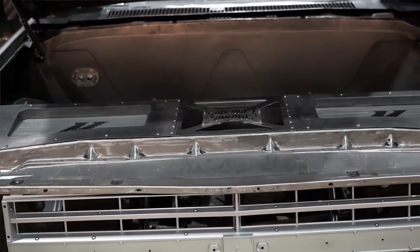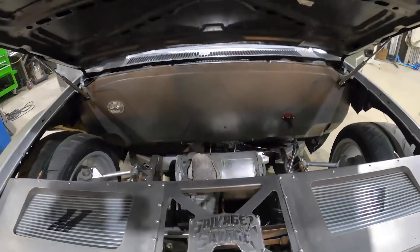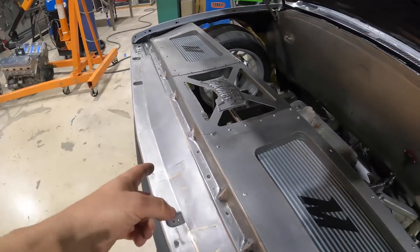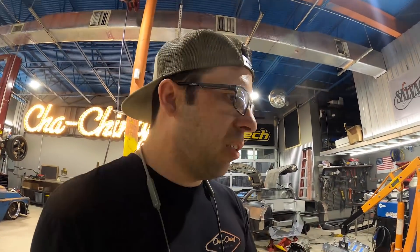Our closeout panel is a wrap. The cooling system is pretty much where we need it and I'm really pumped about how this badge came out. I got a little excited and put the hinges on — they kind of go on like bolt-on factory. I'm sorry I didn't film it, I just got too excited to see the hood on the truck. But the front end is looking really good. The only thing we're waiting on now is that Mishimoto radiator. Once it comes in we get to start doing some plumbing. The front main radiator is for the left battery pack and the rear radiator is for the right battery pack. We've got a couple more things to do before we hand this off to Andrew, who will start plumbing with our Vibrant Performance AN fittings and lines. Next time we'll be finishing up the coolant system with our front radiator setup and running all of our plumbing. Thanks for watching and thanks for subscribing.